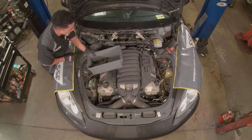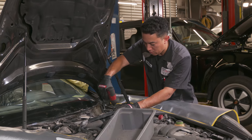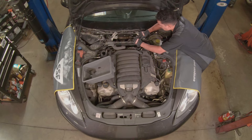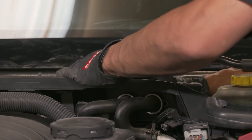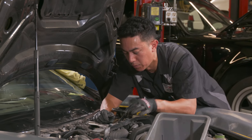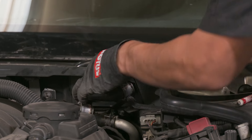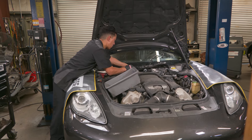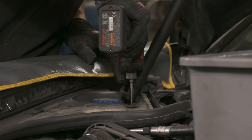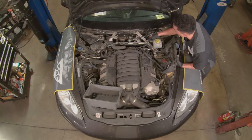We'll do the plug on the back and pull this sucker out of the way. Now we've got that out, we've got some more plastic to move — this wall here. These coolant hoses feed the heater exchange valve in the car, so there's not going to be a whole lot of coolant spilling, so we don't have to drain it or anything. Now I've got the covers out of the way and I've got to remove this metal cross member.